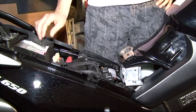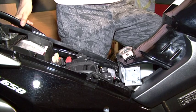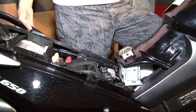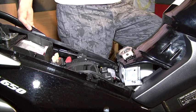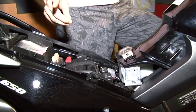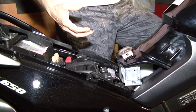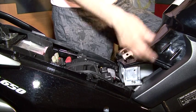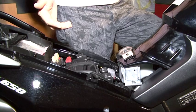The reason to always carry it is because there are fault indications such that if you turn the bike engine off, it will not start again - and this is a big problem because you will get stuck somewhere. But you can get the error reading, the fault indication error, by using this jumper and a spare key that you carry to open the seat lock, pull out the seat, use your jumper and bridge the dealer mode plug, see the indication without turning the engine back off, and then go somewhere where you can fix it, knowing what the problem is.